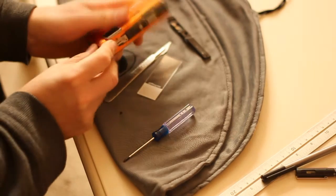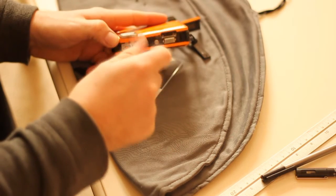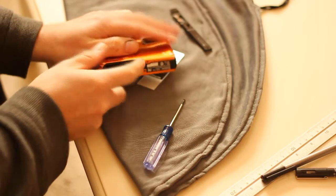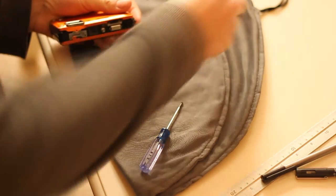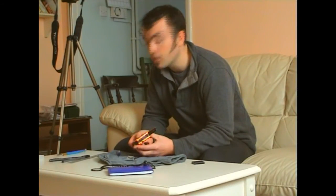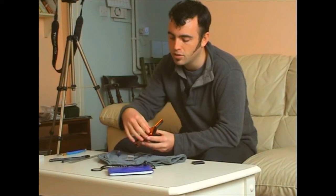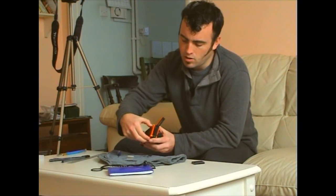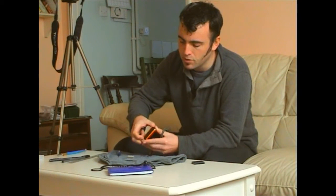It will expose a Phillips head there again. So all you really have to be concerned with is that Phillips there, Phillips there, and obviously this plate that runs along the top. Next thing to note is that there's an adhesive element behind the front panel which I've used a scalpel to cut away. It's quite tacky inside there, so it's not all come to an end.